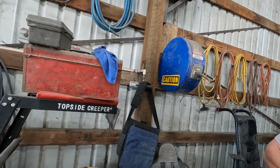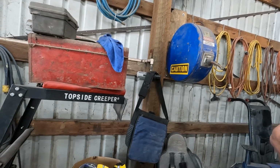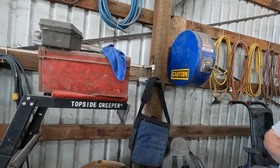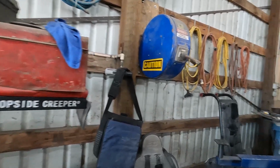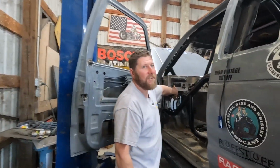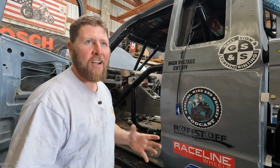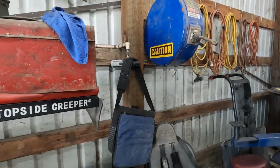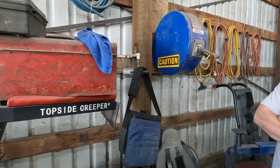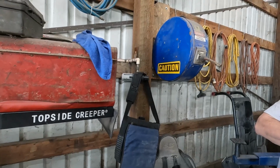Well, see, and that's what works our front axle. That's CO2. How does that play into the front axle? So it's a selectable locker in it. Okay. So it has a little diaphragm in there. That's what this toggle switch does, the one that works the front locker. So it's basically like a normal car, one wheel will only spin. But when you lock that in, both wheels spin. It locks it solid. And it uses that CO2 and it activates it and locks it. And it's like a canister. You get X number of operations? Yeah, I can tell on the charge on the gauge. And then I just go have it refilled.